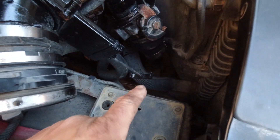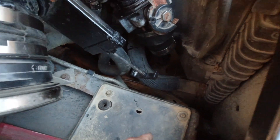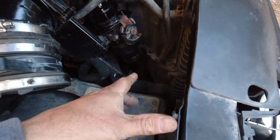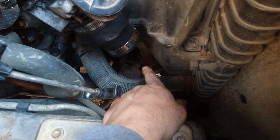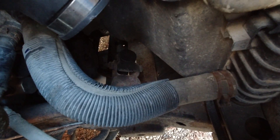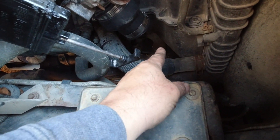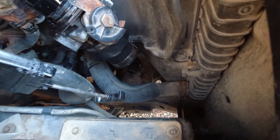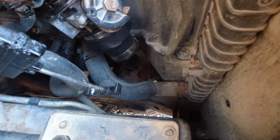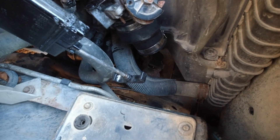The wood gas line - I'm trying just one because with this engine compartment it's pretty tight and it's going to be hard to get two lines up here. There's a PVC line that comes up right there - I'm going to 90-degree elbow that, bring it up through this hole and up into here, and that will be for my wood gas.